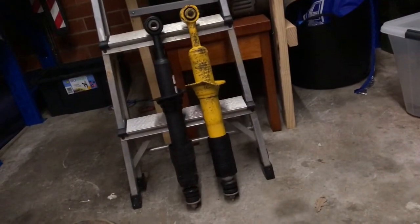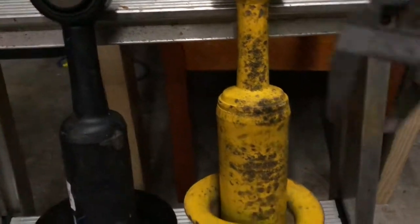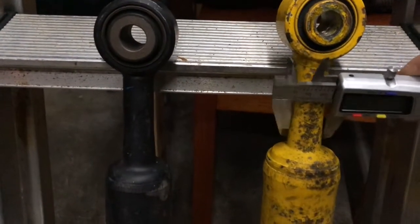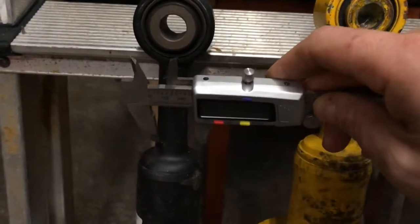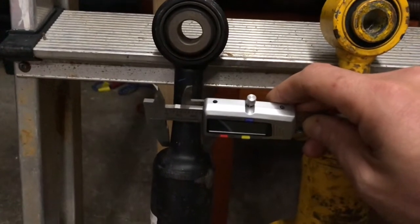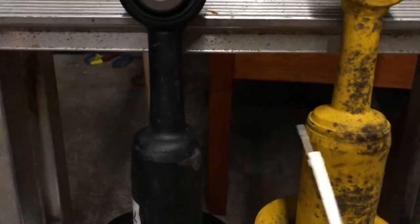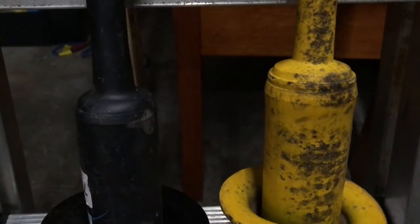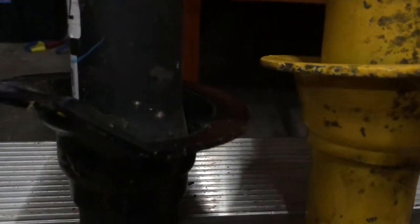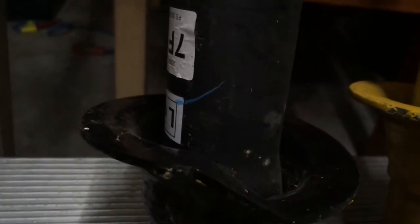And here's the two struts lined up. We'll get in close and have a look at the differences in size here. Again, if we measure at the thicker point of the base, the base of the shaft, and move that directly across to the OE equipment, there's another, again, about another 2mm in it. You can see across the tops here and here, there's a huge difference in the cylinders. Moving down again, once again, hard to see on the screen, the thickness of the metal on the plates here, whatever you call where the springs are received. Again, they're quite different side by side.